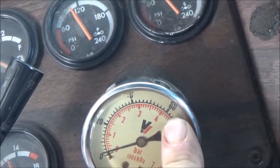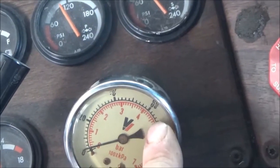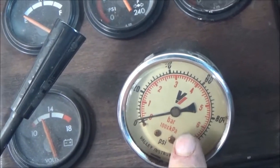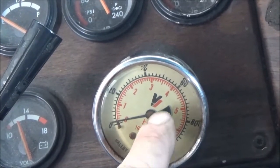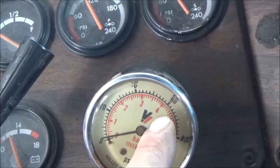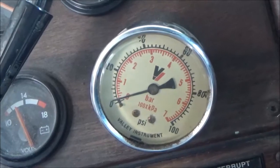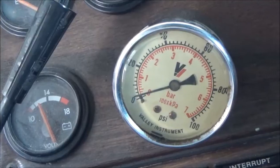When you put a gauge of this type in, you still have to go over a scale, axle out, get your paper from the desk, and find out exactly what your weights are — so you find out exactly where your gauge is going to read when you're at thirty-four thousand. Once you learn how to use this gauge, you'll know where your weights are without having to go across a scale.